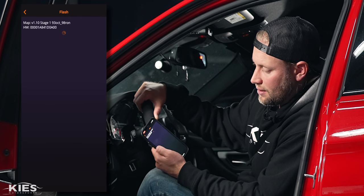Now that we know it works with Bimmerlink, I'm going to hit that button three times again to get it into diagnostic mode. I need to set this over to manual — now it's 192.168.16.107. Going into Boot Mode — at the time of filming this video flashing is not available via OBD for the G80, although I hope it is very soon. However I still got a license so that I can do data logging and whatnot.